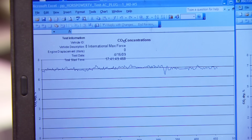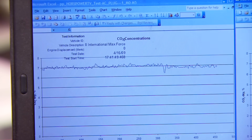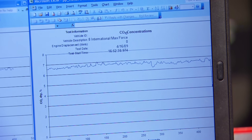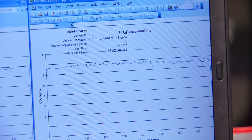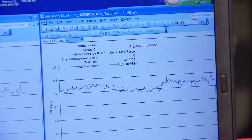We install the E3s to duplicate the first run - water temperature, oil pressure, everything's got to be exactly the same. Looking at the CO2 from the first set of plugs, we're a little over 7% on the CO2, which is basically an equation of fuel economy. When we look at the E3 plugs we're at 6.8% pretty consistently across all the runs - about 2 to 3 percent better. The CO readings show very similar numbers with not much change.